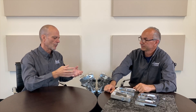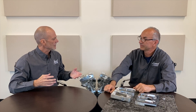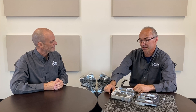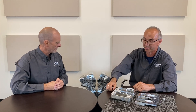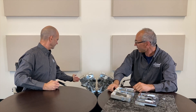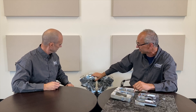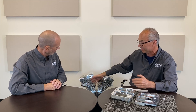These are really big improvements over the existing rocker boxes. What does the builder need to take into consideration for a build so that there's proper fitment? Finding extra space in any motorcycle is always a challenge — it's just the nature of the beast. Shovel heads are no exception, with the backbone and down tube of the frame notoriously in the way of the rear head assembly. So we machined a couple of recessed areas in the rear rocker boxes and also in the rear head. That, plus the fact that our heads are a little shorter than the original, allows the builder to use taller cylinders in case he wants to build a stroker.